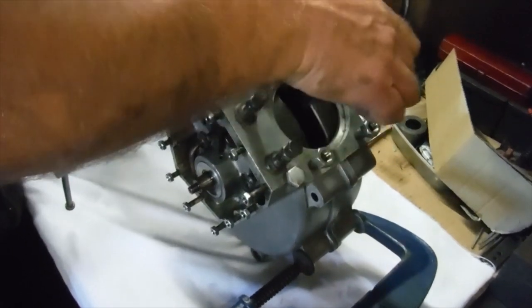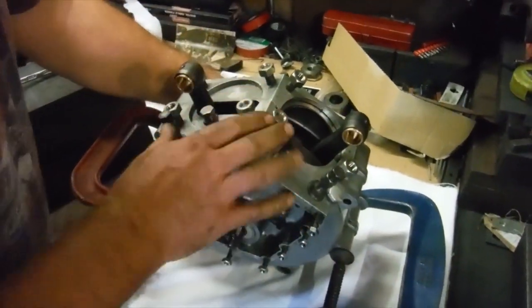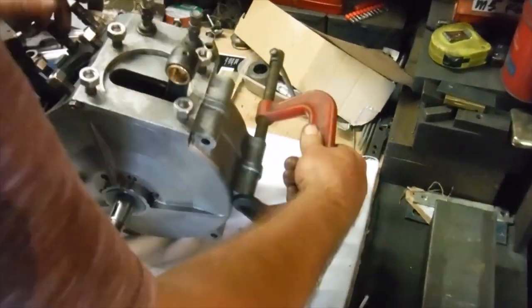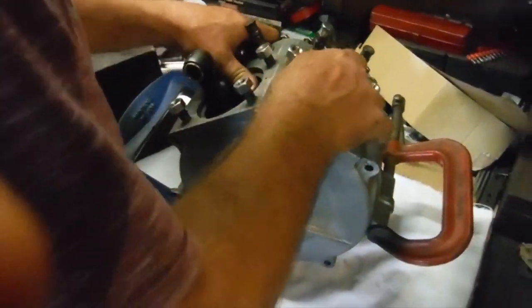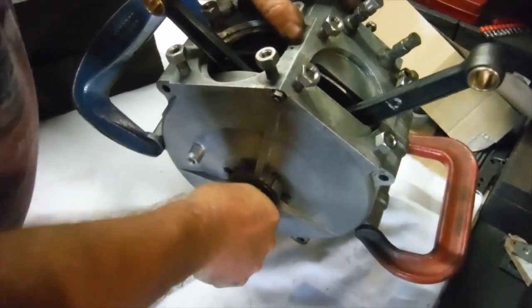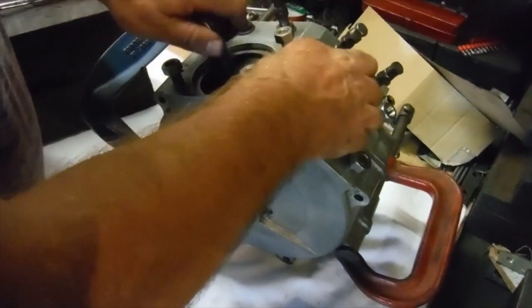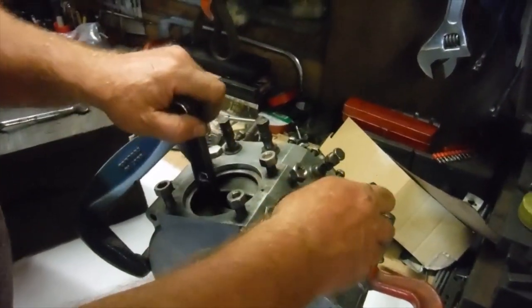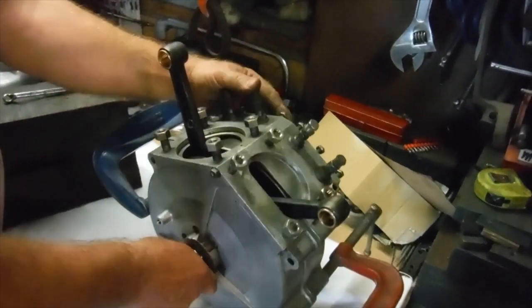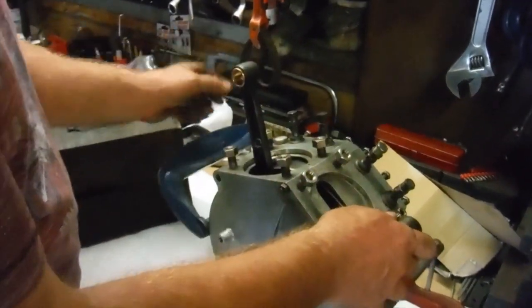And then we've got the crankshaft turning nice and freely and smoothly, and if I can demonstrate it, you may just have to take my word for it, but I'll try. There's absolutely no side-to-side movement or end float, and yet the crank spins nice and freely, so I know that the crank's not going to clatter about from side to side. And a good positive strong oil feed to the big end bearings will be maintained. So I'm happy with that.